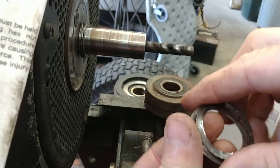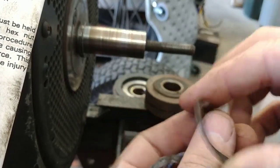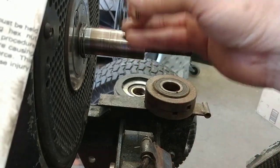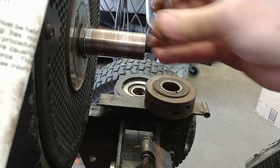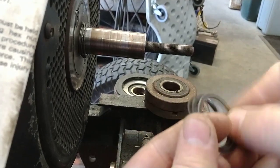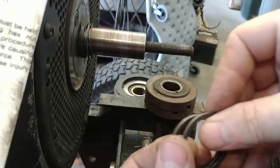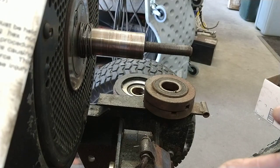Generally you can just replace these wavy washers. These are new ones and they were exactly the same shape. Someone had already rebuilt this clutch — there was even a new shaft, a different type of weld, and a new bolt welded in. So here I have my two wavy washers, then a thin washer, then two more wavy washers, then another thin washer.